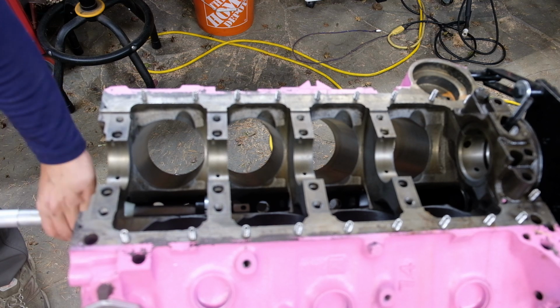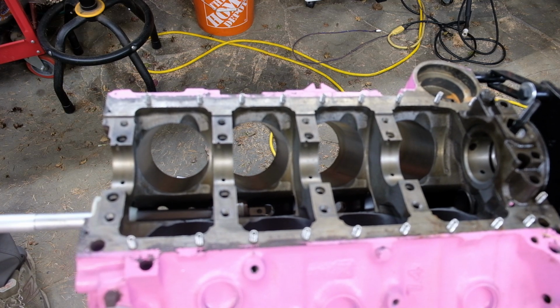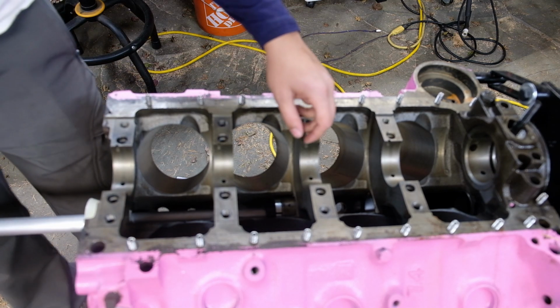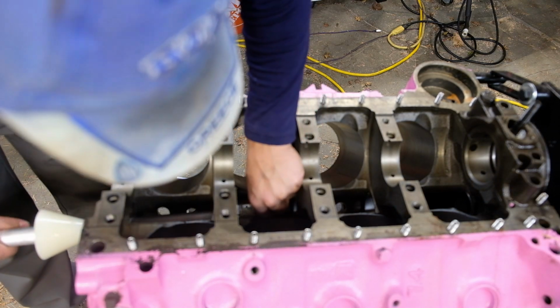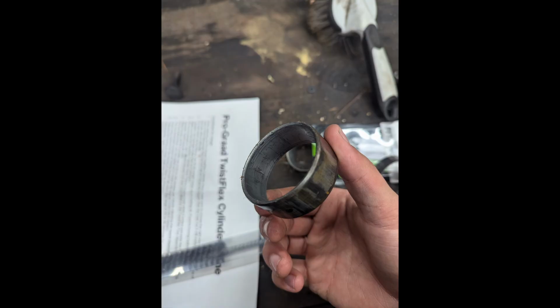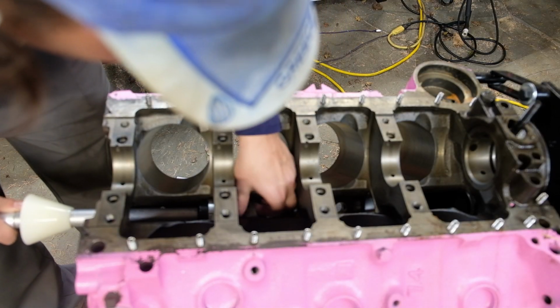Well, one of the clearances I didn't check and bearings I didn't replace were the cam bearings. These are fed off of the mains and wear like junk because of the uneven cam loading and can leak a ton of oil. Even though the cam fit pretty snug in the old bearings, after taking them out, they definitely weren't doing too well. Either way, pulling them out lets me clean the block better, so it's definitely good to do it either way.